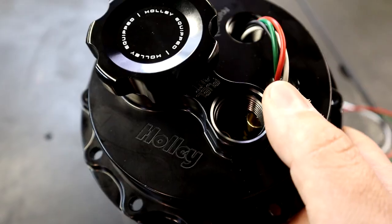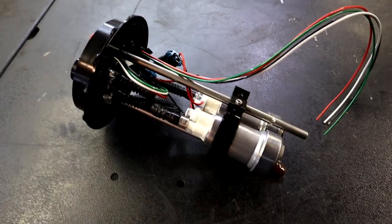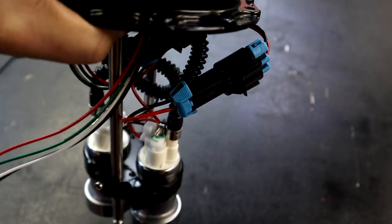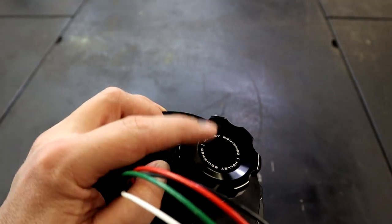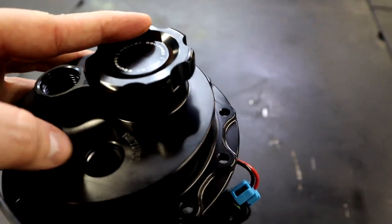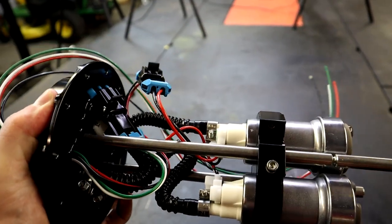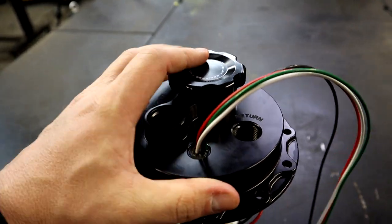These work great with fuel or E85, and having two 450 pumps, this thing is definitely going to flow more than enough E85 for our needs. It's also going to be a pretty easy install and the wiring is going to be a piece of cake. It's a very well-made unit — all the hard wiring is already done for you and everything is pretty much ready to drop into the fuel cell. On top of the fuel hat you have the fill port, the fuel inlet, the return line, and your wiring comes out the top. There are only four wires that run both pumps.